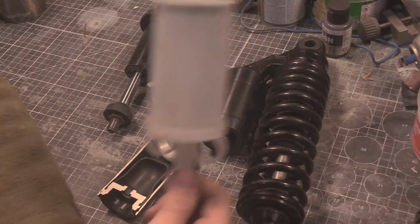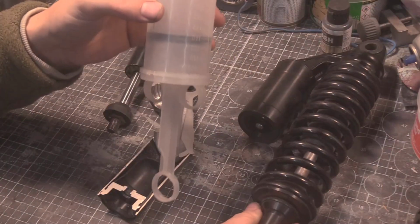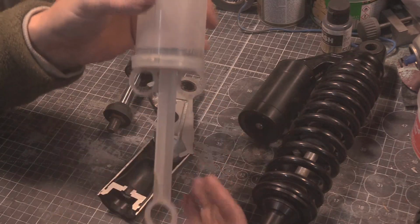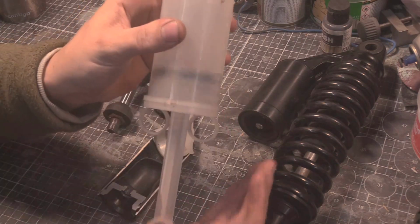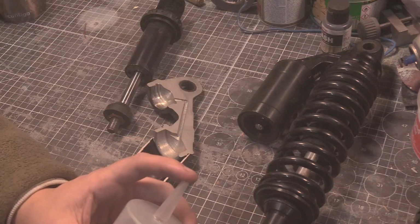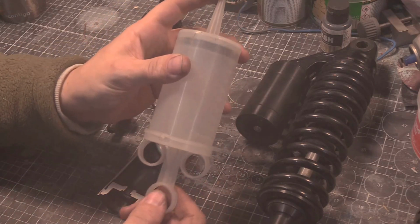If you think about a syringe, we have the same thing: a cylinder, a piston and a rod. So this and this are very akin to each other. I can only squash that so quick. Imagine between there and here I have a spring, so then you've got some kind of damping. Now, if I reduce this, I control the rate. If you put a valve in here instead of using my finger, then you are making adjustable suspension. The damping rate is adjustable because you can control the rate. It's not just how much force, it's the rate at which it accepts that force.